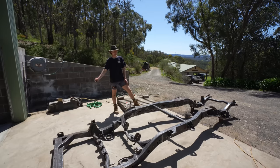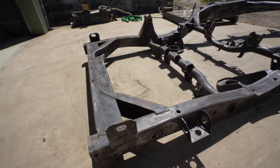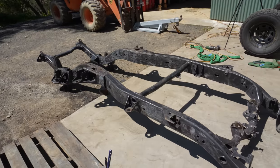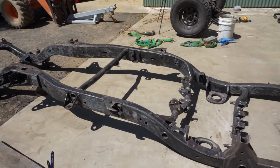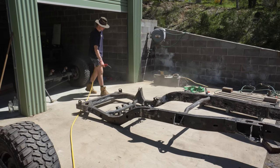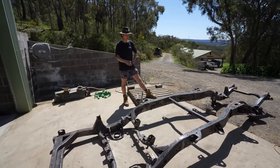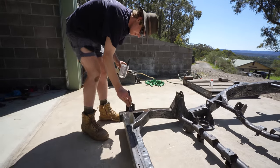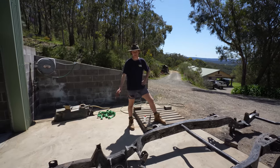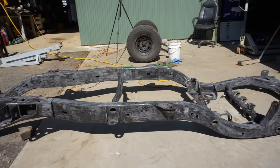We've ripped the diffs out and flipped the chassis upside down so now I can access the whole underside for wire wheeling — just going over the whole bottom side anywhere I couldn't access when the wheels were still on. I've just finished wire wheeling the bottom and all the other little bits I couldn't reach before. I've gotten off pretty much all of the weird flaking paint, which is the stuff I didn't want on there. Now I'll give it a quick blow off with the compressor, hit it with the rust converter again along the bottom, let that sit, then flip it over, wipe it down with solvent cleaner, and start setting up all the chassis bracing and tray mounts to be welded on.